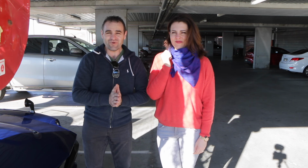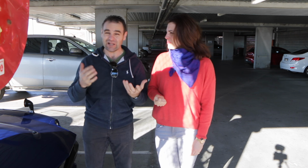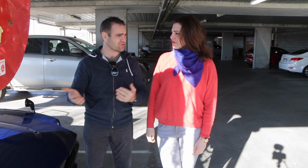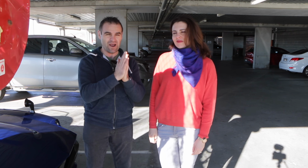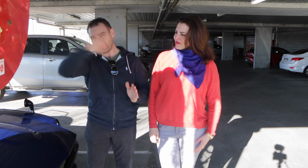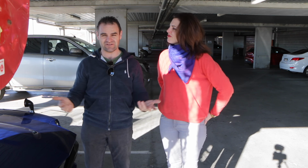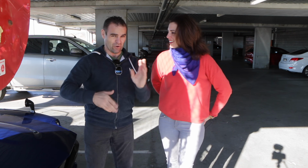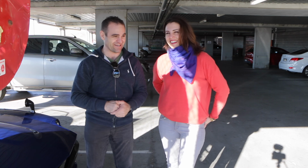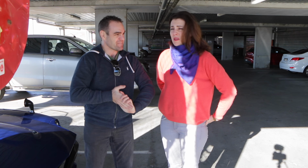All right, final morning. We're heading back now, and the car's actually been working a lot better. The battery seems to be running properly now. The amp meter, before, every time basically I put any revs in at all, it would go off the charts, plus 45. Now it's sitting down around the centre, and the battery still seems to be working properly, and I'm not sure whether it's boiled off enough acid to do it, but it's not overcharging anymore, and the battery still works, so we haven't used the spare, but it's there just in case. It smells a lot better too.